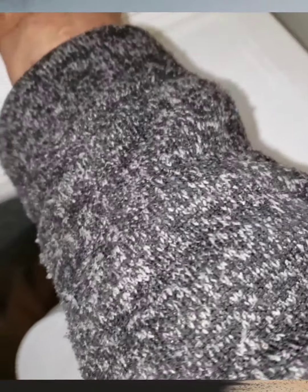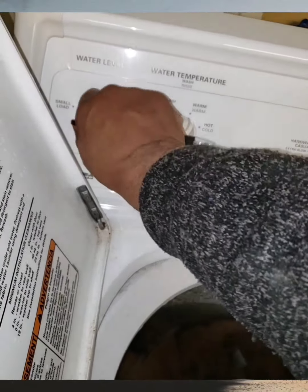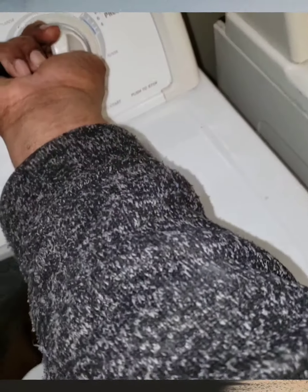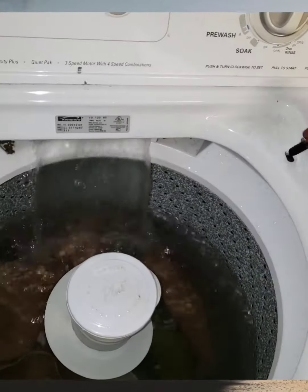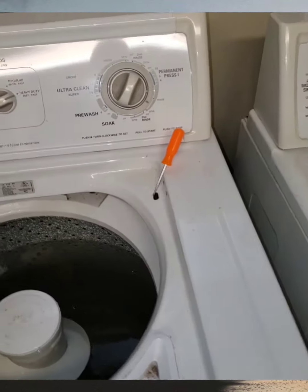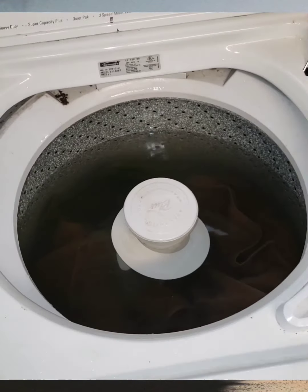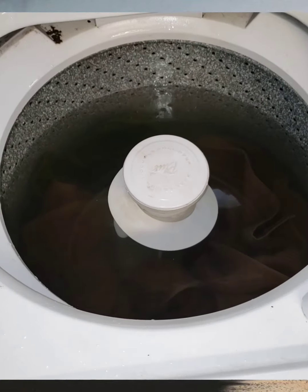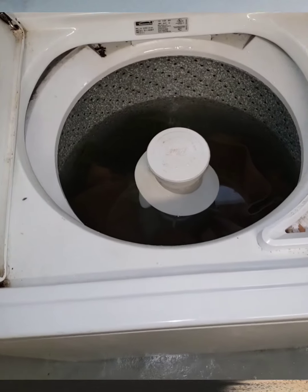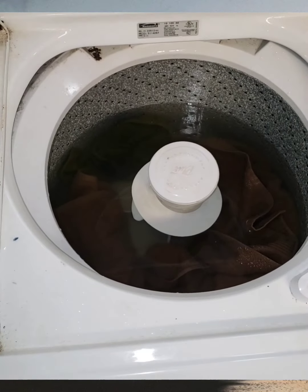Re-verify neutral drain on every level. Large, medium was verified, small was verified, large just verified. Now medium. Now the timer will stop, and the water will begin to drain 80% so that the motor does not have to strain to spin the water out of the fibers of the clothes.